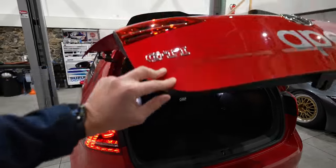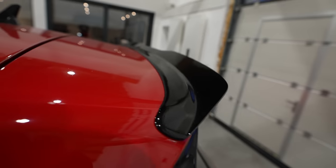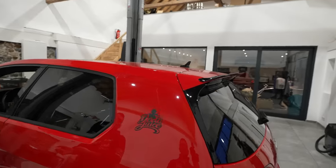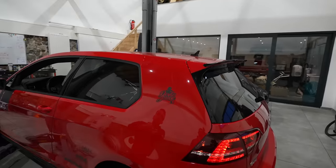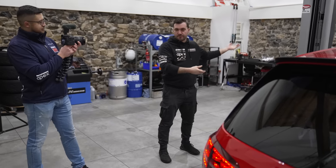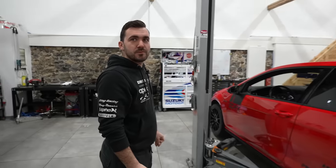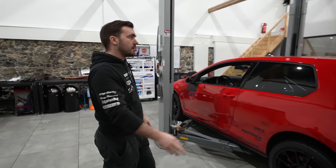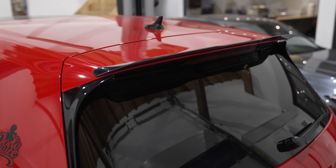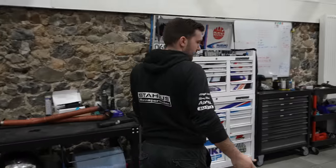Now look at this massive wing — it probably adds 13 and a half kilos of downforce, which is why we had to run eight kilos stiffer springs. All jokes aside, the question is: do you really need lots of aero on your car? You don't necessarily need it, but the Nürburgring has a lot of high-speed fast corners. A stock Yaris, for example, is a bit nervous through there and could probably do with some better aero. There are companies that make adjustable wings for Golfs and Cupras that do make a real difference — keeping the rear end a little more stable.